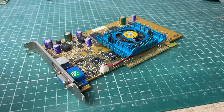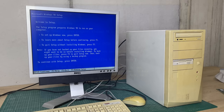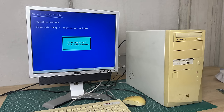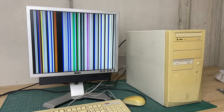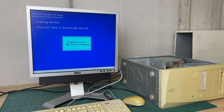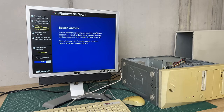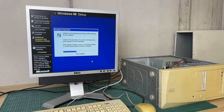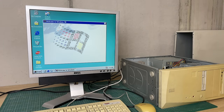As I was planning to replace Windows XP with Windows 98, I booted with the Windows 98 CD-ROM and went through the installation, which also involved formatting the hard drive. Everything was going fine until I came back to the PC and it was looking really not normal - strange graphical corruption. I put it into diagnostic mode, laid it on its side, reseated all the cards, and went ahead with the installation. Everything went fine after that - no hangs, no freezes, no blue screens, no weird artifacts - so I assumed it was just a one-off thing.